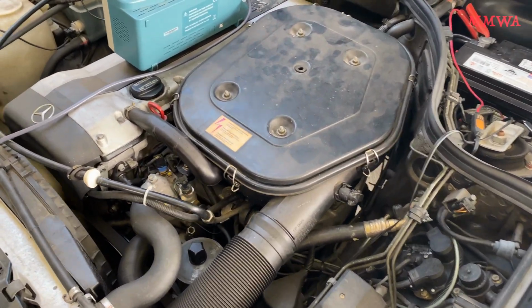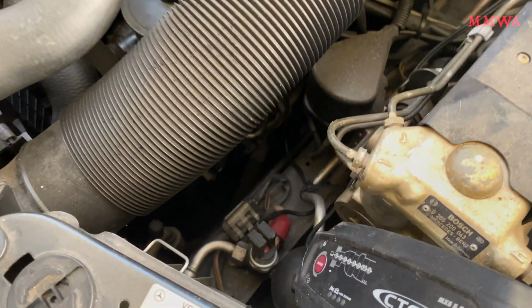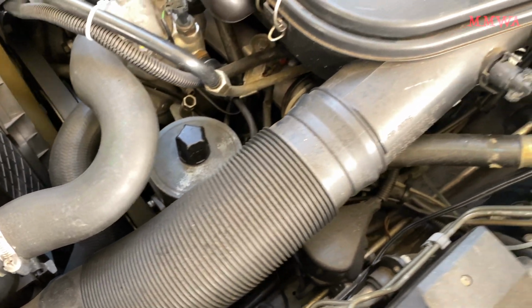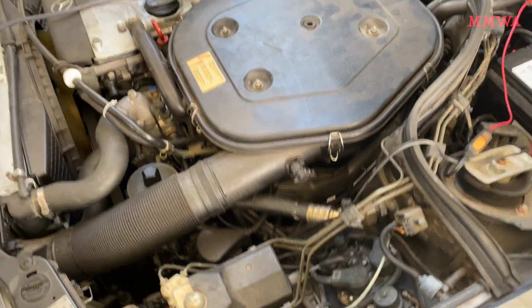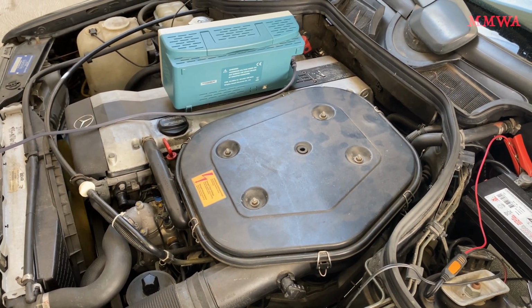Oddly enough, there is no hissing noise with the car just started up recently. I suspect it's the throttle body expanding and leaking on a very long drive, because I don't normally hear that noise, and it's probably just a bit of wear in my throttle body.